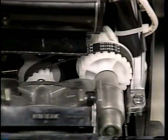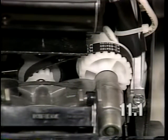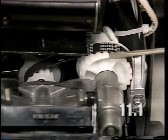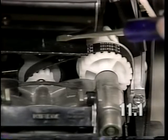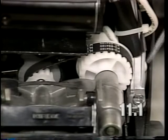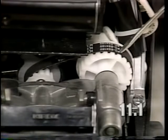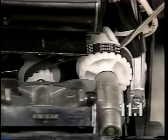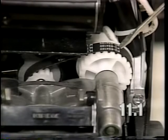If upon inspecting a machine, you find that there is a lot of dirt inside your base pan area and your transmission gear and your motor sprocket gear are worn and full of dirt, possible causes could be a leaking motor seal or a torn horn gasket. Inspect for the conditions as follows.